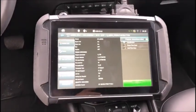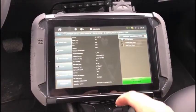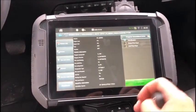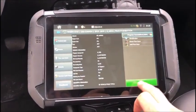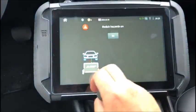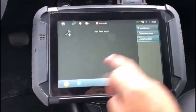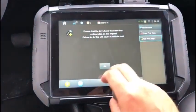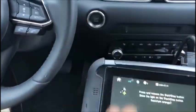Not needing to pay for anything — it automatically and seamlessly bypasses what used to be a big headache for lost keys or duplicate keys. I've selected 2018-19 Mazda CX-5, ignition is off, hazards on, and we are going to select 'Add Proxy' and show that the keys have the same configuration as the original. Press the start/stop button.